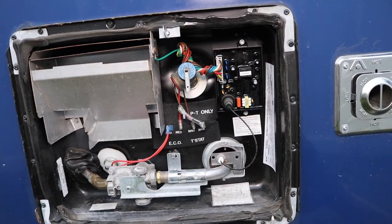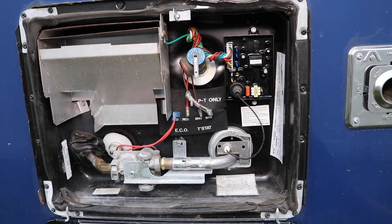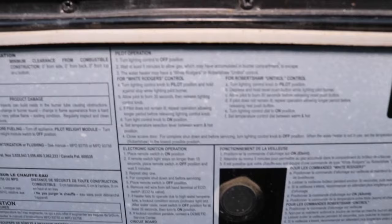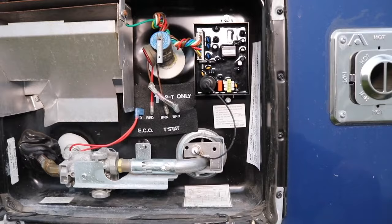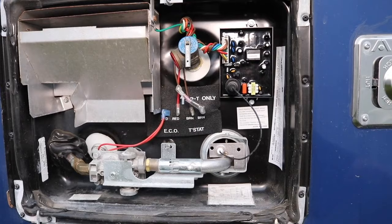All right, so that is it — a few tips on how to troubleshoot your water heater on your RV or travel trailer. Hopefully it helps you out next time you're camping. On our model you might have a little guide here that tells you how to troubleshoot and what to look for. For example: before replacing the circuit board, remove and clean connections to the circuit board and ignition sense probe, and check for a short in the valve or light wiring that may have blown a track on the board. If you liked this video and found it helpful, make sure to like it and subscribe. Thanks for watching — we'll see you at the campground.